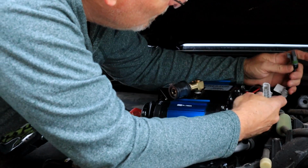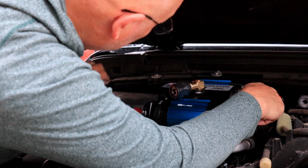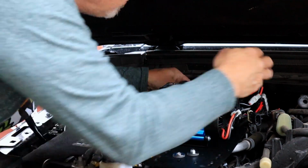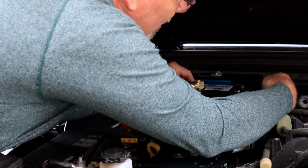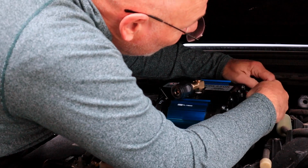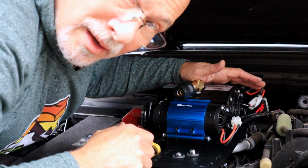That simply plugs in to this connector here, and what I will likely do is bend this stuff back behind this hose and route the wire similar to that, so it's tucked up in there really nice. Now for the small one, and I should be able to do the same thing here if I can get my fingers on it. Yes, and there it is. And here's the connector for this, and I think I'll keep it on top. These are polarized. You can only plug them in one way. No issue there. Then I'll cut my cover and cover up the wiring here with the cover.